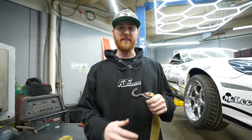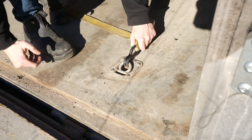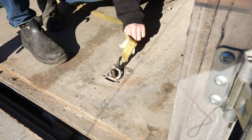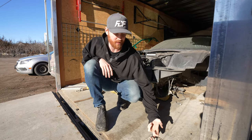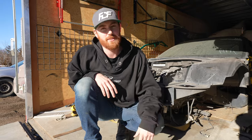One more tip for inside the trailer: most trailers have D-rings in the floor. A lot of people hook the strap on top of the D-ring, but if it loosens, it can come off. The best way to connect is underneath the D-ring — if there's any tension at all you can't get it off, and even with complete slack it'll maintain itself in the D-ring. That's your Just a Tip Tuesday. Comment if you have any additional points — people will read those and get more advice. That's my opinion; take it for what it is. See you in the next one.